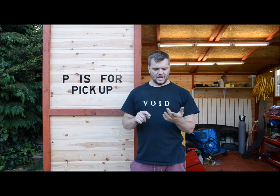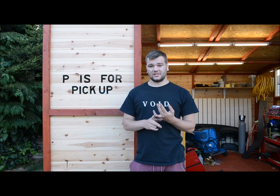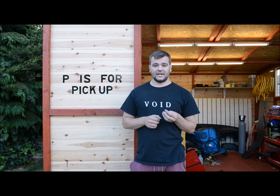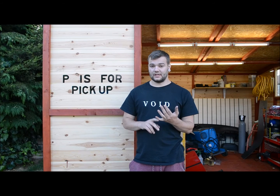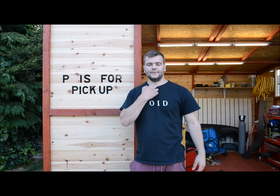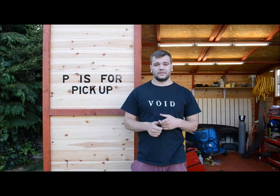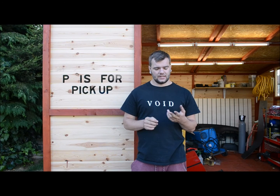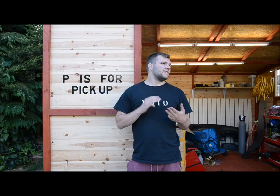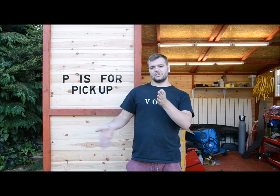That's the end of episode 8 — just a little one. I've got the other side cut for the buck, I've got an idea of what I'm going to do for the back where the rear lights go, and I've started drawing out a template for the floor pan. I'm going to get the other side welded in, then design the floor pan and get some metal — probably three mil or a bit thicker. I'll put that in first, then do the back bit so I can get that bar at the bottom in nice and straight and welded to the bottom plate. Job list: first, finish the metalwork in the buck. Second, do all the bits in the engine bay — intercooler, pipework, coolant pipes, air filter, expansion tank, etc. Then fit the over fenders front and rear, drill holes, get riv-nuts in. I won't do the back ones until the buck is done so everything lines up nicely.